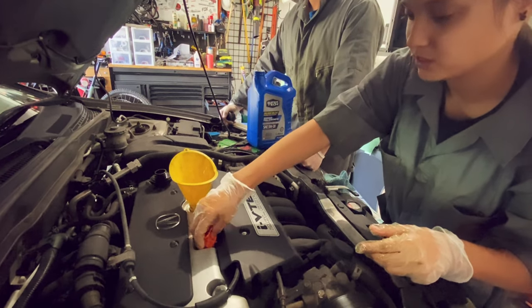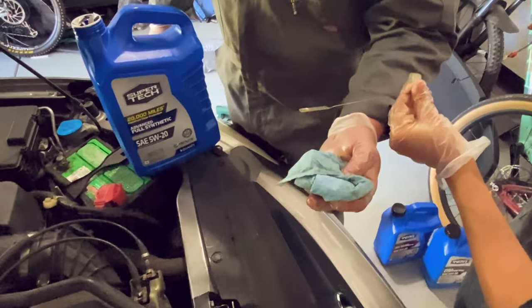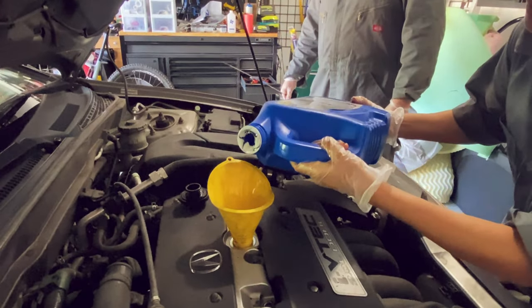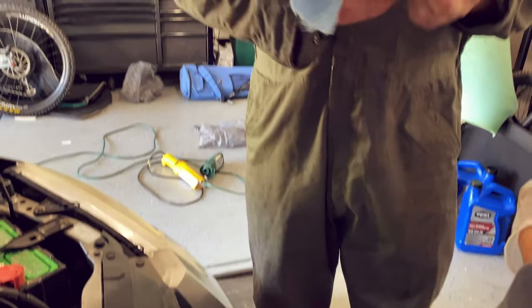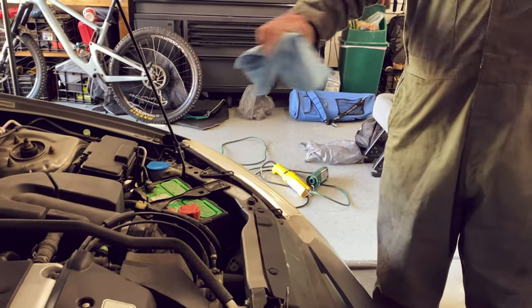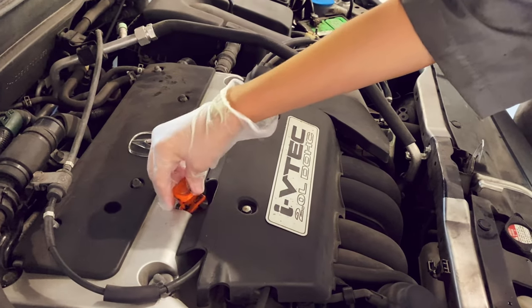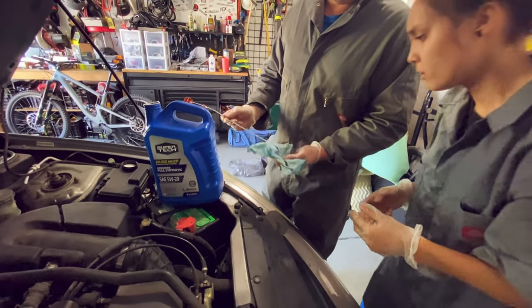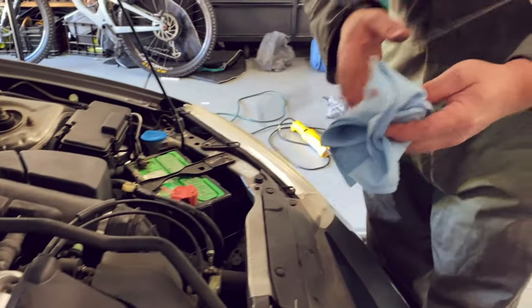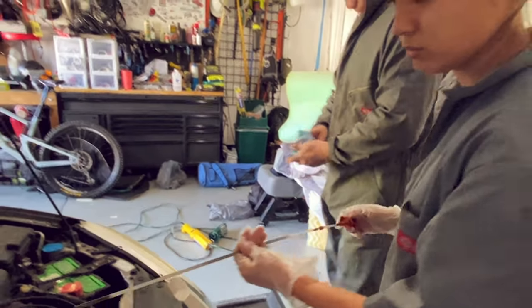Don't force it — there you go. You see it? Yeah. It's not quite there yet — it's at the low mark, I need a little bit more. We're going to check it again. Can't trust the first reading because the oil sloshes around when the oil pump is sucking up oil. When you take it out you want to immediately turn it like this. It looks the same — it's not moving. That's perfect right there — see right there? The dot — perfect, perfect.